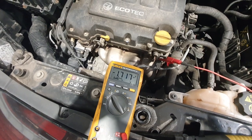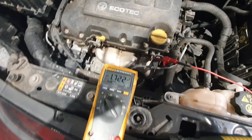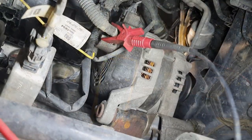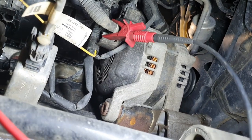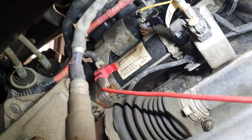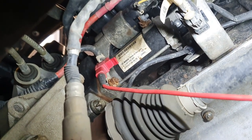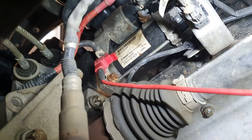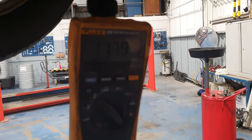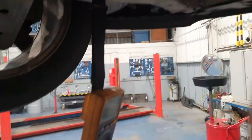Let's just confirm that the alternator is still charging okay. Let's go underneath and check the voltage at the alternator to a good ground. So underneath the vehicle now, I'm on the back of the alternator positive connection and on the starter motor ground connection, and we are still showing 11.8 volts on the charge.